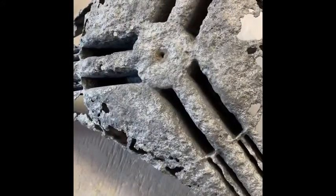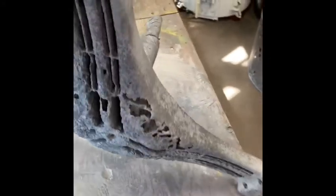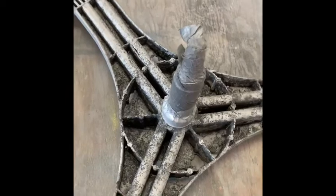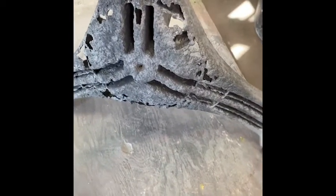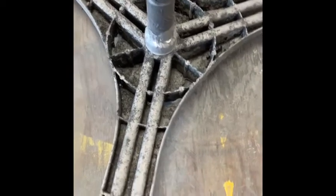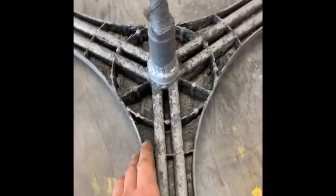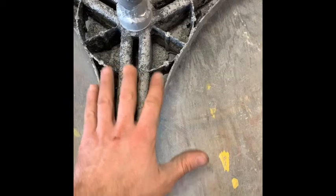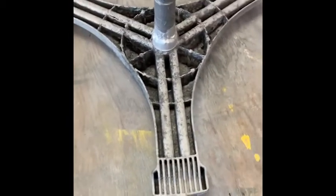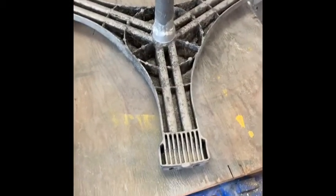Now you can see what's left — it's quite heavily pitted but still feels fairly solid. Filling all these voids with the special epoxy will strengthen it, and then gluing the whole piece onto the bin with the thick two-part sealant should also give it strength and prevent wobbling, even if there's a weak spot. With all these voids filled, this should be solid as rock — I wouldn't be surprised if I get ten years out of it, or whatever the rest of the washer's life is.